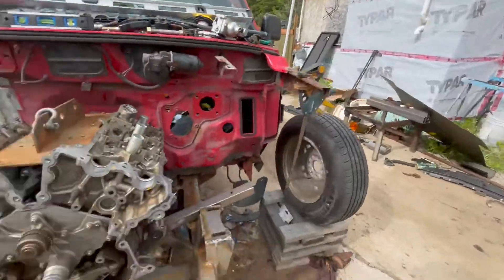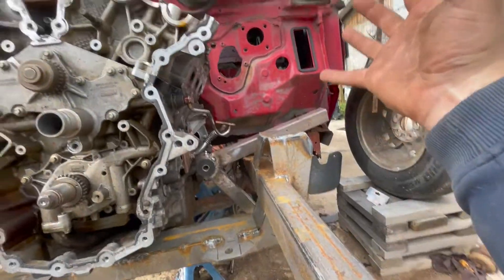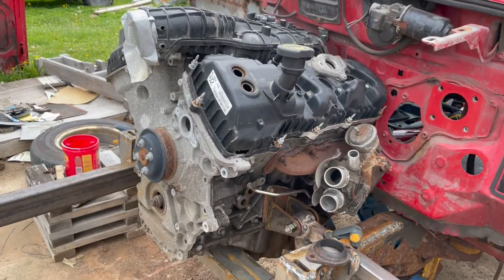The reason I went to the Mustang II was because I didn't have clearance for the alternator between the power steering box. Well, look at all of the clearance I have for the alternator now — it's basically wide open here. This Mustang II crossmember actually fixed a lot of my issues, but it did cause one more with clearance for the engine. So if I can get the engine sitting a tiny little bit lower I'll be happy — if not, then I guess the big old hammer is coming out and we're going to smash the firewall.